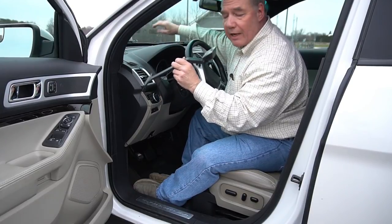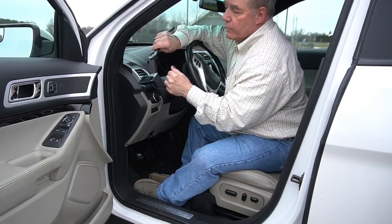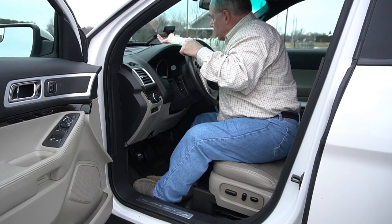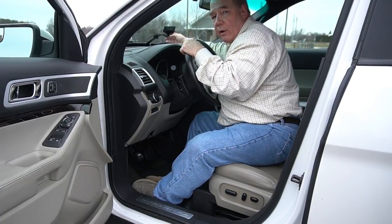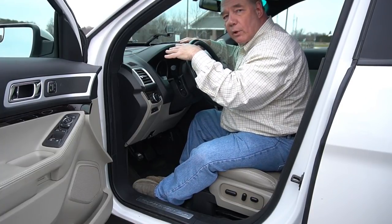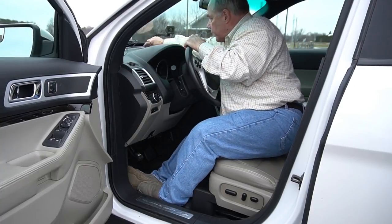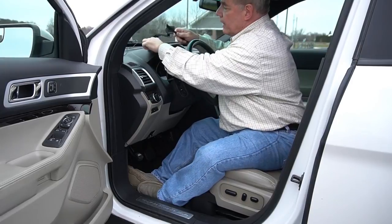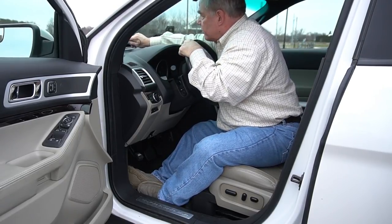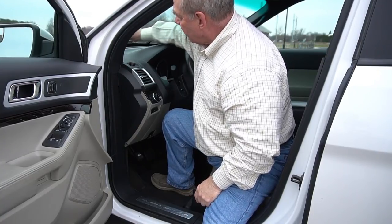To mount it to the windshield, tuck the foot in between your windshield and dashboard. There's a clip with a suction cup on top — when you close the clip it pulls down on the center of the suction cup, really adhering it to the windshield. Start with the clip open, slide it down to the midpoint of your dashboard, push it up against the windshield, and close the clip. This thing is not going anywhere. I've got it high enough above the windshield wipers for a clear view of the road. For the extra cable, use the tuck tool — that little divot grabs the cable and lets you gently tuck it along the windshield until all the cable is neatly hidden.